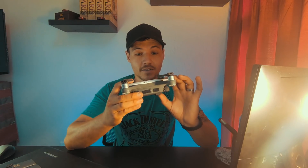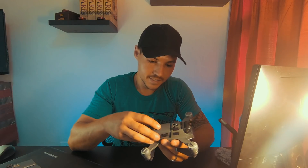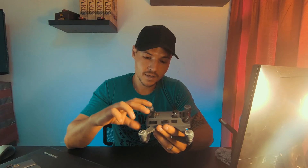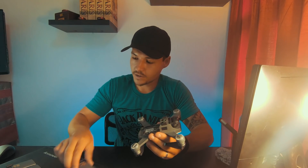I'm going to show you what I did to give me peace of mind after taking my drone up in the air. One thing to check when you have a faulty battery — the battery has these small clips, small fragile little clips. They do work individually; if one fails the other will hold it fine. But to check if you have a faulty battery, push your battery in and you should be able to pull it out without any pressure. As you can see, none of my batteries do that at all.